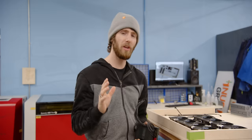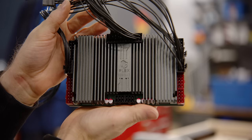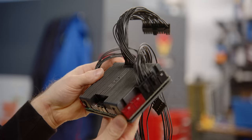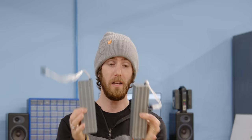When it came time to choose a power supply, most options were absolutely terrible — you can get 1U power supplies, even fancy redundant ones, but the issue is they're designed for servers, which are not made to be quiet. So we went with one of these: an 800 watt DC ATX power supply from HD Plex. We've got enough power for a Threadripper and RTX 30-series graphics card, but passively cooled and super slim. These get used for everything from computers to AV to any situation where you need a high power DC supply. Of course, DC power supplies still need to do the AC conversion from the wall, so for that we're employing two 400 watt power bricks, also from HD Plex.